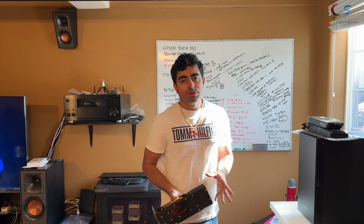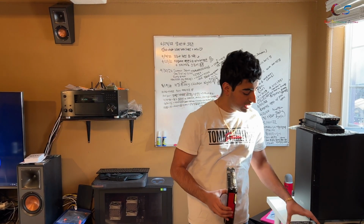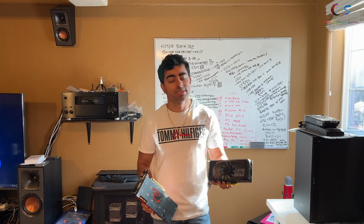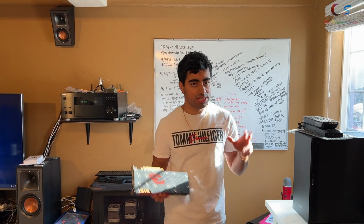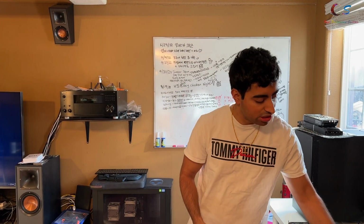Alright, so we already ran into a problem. You can't really mix the 200 series with the 400 series. And I think the 400 series is when Nvidia made the unified driver, meaning that you can mix the 400 with 5, 6, 7, 8, 10 series, whatever.